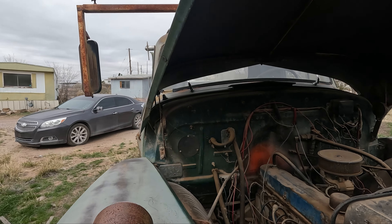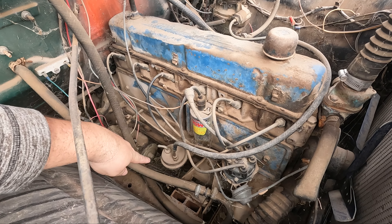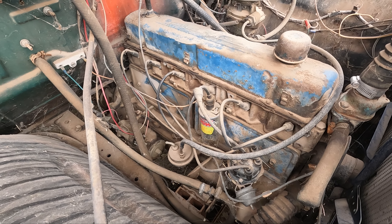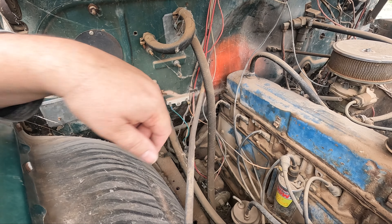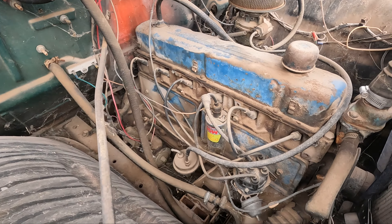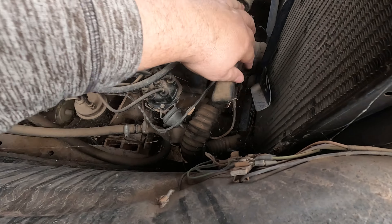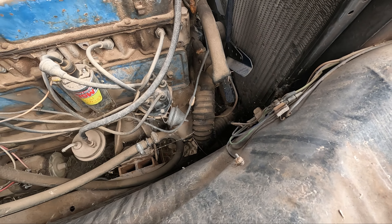This thing does not go up very high to have a lot of headroom. Wow, that coil looks relatively new. What year was this thing tagged? Look at the fuel pump — it looks like this has been worked on recently. Ballast resistor. Wiring looks good — this doesn't look like it's gonna be hard to get going. I didn't even think about bringing a hose clamp. Look, we're missing our vacuum line there — oh, there's our vacuum line. Let's get a stick and evict these spiders. Man, this thing looks good.